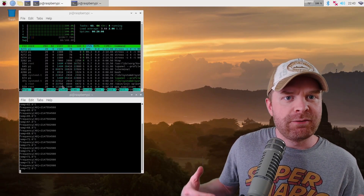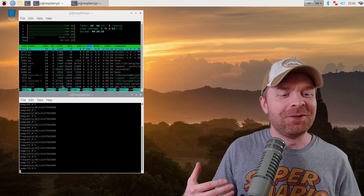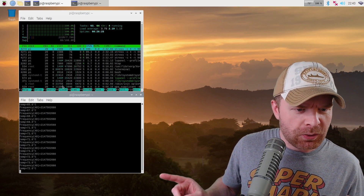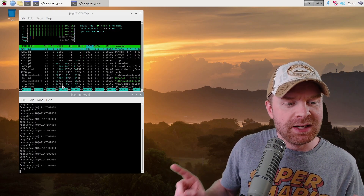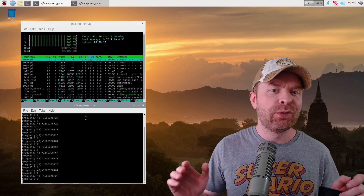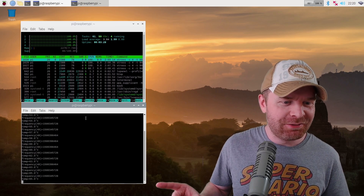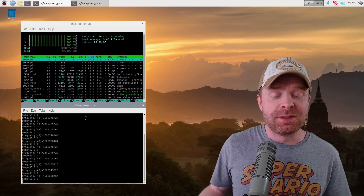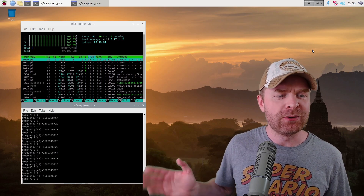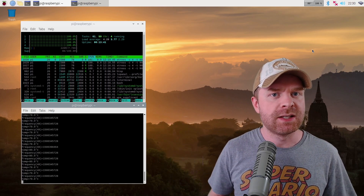I'm running the stress test again with the fan on maximum cooling speed — full speed. I don't know if you can hear it right now, but it's really loud. The stress test is running and you can see it hovering around 72 to 73 degrees. I hope it's holding steady — if it can hold at 72 or 73, I'll be very impressed. Now I've removed the overclock from the Raspberry Pi and I'm running the test with no fan at all. The temperature is sitting at about 65 degrees Celsius. We just hit 80 degrees — actually just under 80, we went back down to 79. I'm going to stop the test, but it's held up very well for quite a bit of time at full load using just passive cooling, just that little copper heat sink.